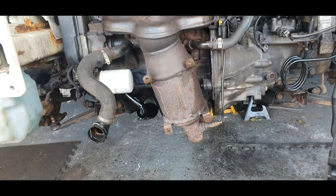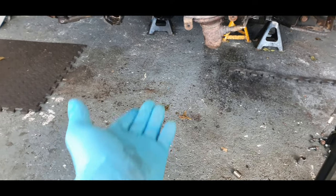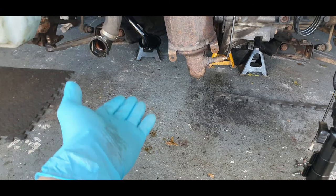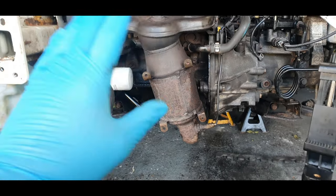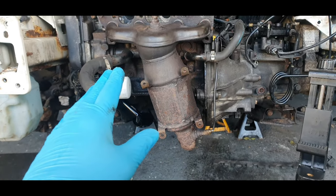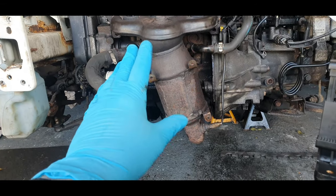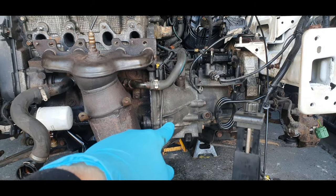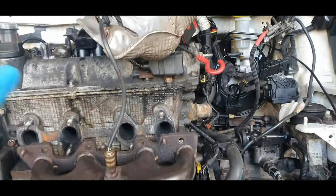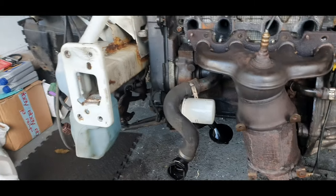We're going to put this sump back on. So I think the best way to tackle this now is if I get the sump out, put the gasket sealant around it, and I think I put the jack under it, lift it up so it doesn't come off, and then I can put the bolts in while the jack's underneath it. And then what I'll do is just leave that set. I should imagine it'll probably need about 24 hours to set. I haven't really read the label yet. And while that's setting, we can fill it up with oil, but I won't run the engine until it's sealed 100% and dried. I've got some gearbox oil to put in there as well. But there are other things we can do before running this engine anyway. So let's crack on and get that sump back in.